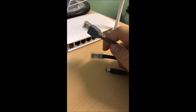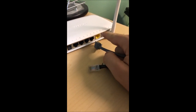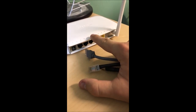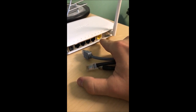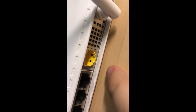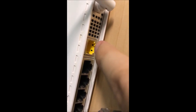Take the modem cable — the one plugged into your modem, probably a really long cable — and plug it into the yellow uplink port on the back of the router. Some ports are blue or green on different devices, but look for a port that looks completely different from the others, a different color or labeled 'uplink.' Then on your modem, find a port that looks like an ethernet jack, plug an ethernet cable in, and run it to this device. Next, use another ethernet cable and plug it into the back of your computer — I usually go for one of the ports in the middle.